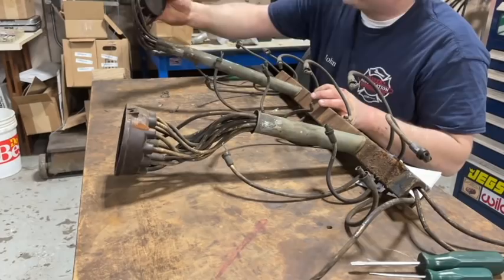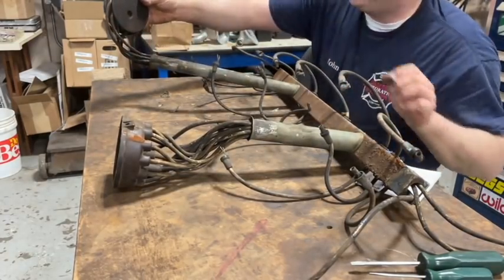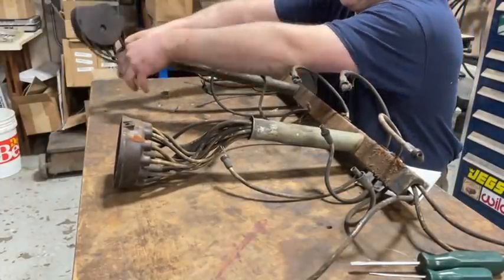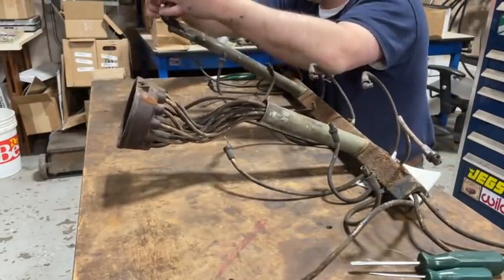And you look at your distributor cap, and on a magneto, this one here is actually stamped with a 1 right here. So this should be cylinder one. So I'm gonna follow this wire and push and pull, see if I can take this off.